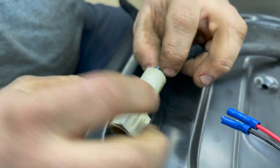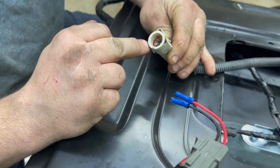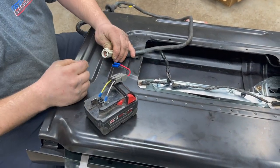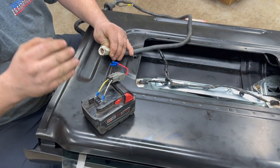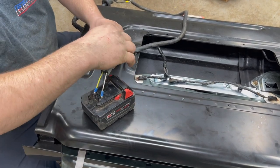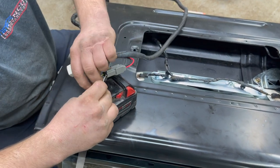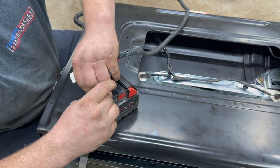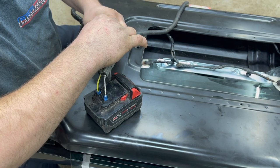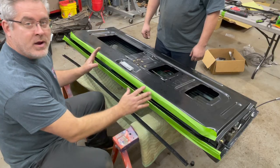The two purple wires are at 180 degrees from each other — in this plug it's the one on the flat side and the one 180 degrees opposite. Give it some power and run it all the way in. If you're using an 18-volt source be careful — it can go a little fast and you don't want to go too far in the wrong direction. Got it right on the first try and it's all the way in. Now we can start working on the felt.